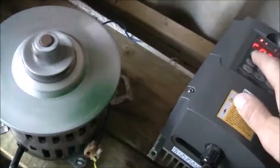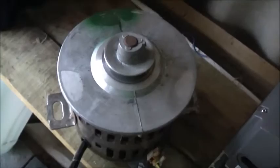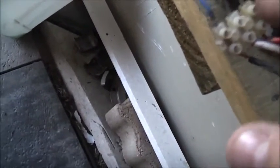Should get a pretty good profit for it, even though I got it for free. Let's measure these windings — about 20 ohms. Between each of these pairs of windings they're all probably about 20 ohms. Double-checking: 20 ohms between there and there, 20 ohms between there and there, and there and there — they're not quite the same.